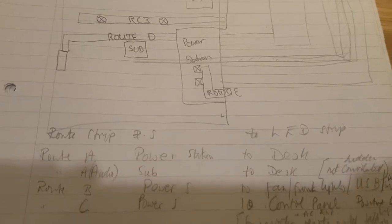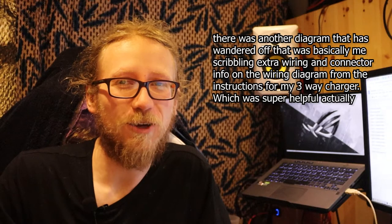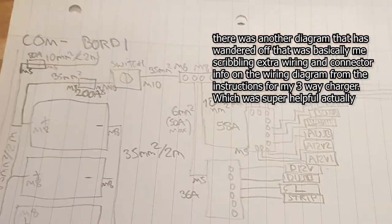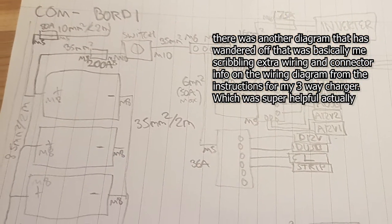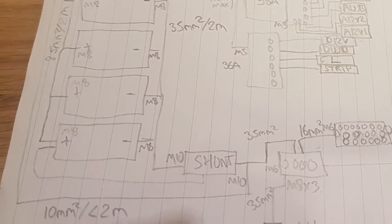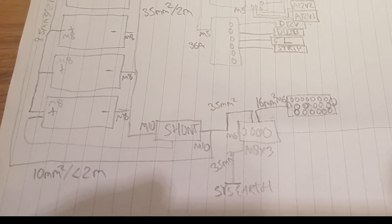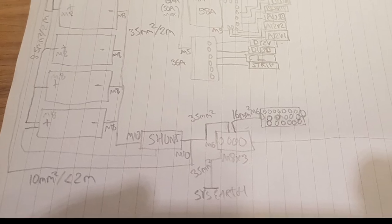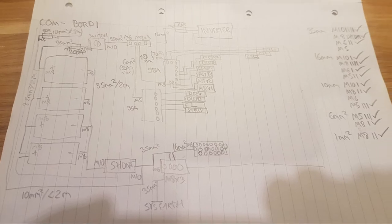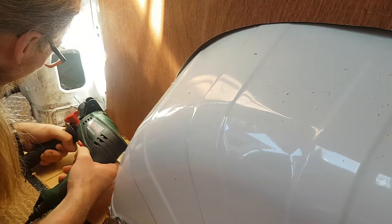Because it's not just all the components — it's figuring out all the sizing of the cables and figuring out all the various connectors. There is no way around this really other than to draw a map of the entire thing that you want to build, with every cable size, every connector size, because there's such a mishmash of different ones. So I actually drew the diagrams, figured out the circuits, did multiple different pictures to figure out how to build this massive 200 amp system.